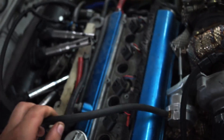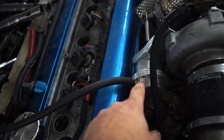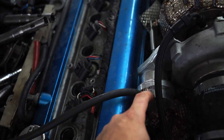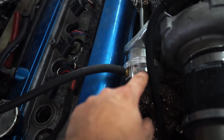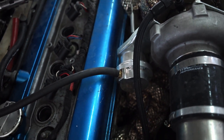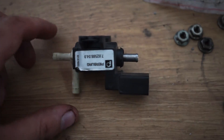This is the same way as with the other one — it's just run to a boost source, and that's how an internal wastegate is set up. If there are multiple ports, so you have multiple ports here and here, and you wanted to run it with spring pressure, only connect it to one port and leave the other one open. If there are multiple ports in one chamber — on the top or the bottom — you need to close off the others so that pressure can actually build up inside the actuator.